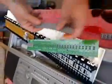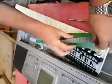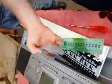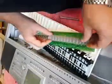Then you can take these circuit boards and wipe them with a cloth, making sure that the circuit boards are all nice and clean. Then the key contact rubbers go back, and you just reverse the whole process and screw the whole lot together and you're good to go. Don't use any kind of spray contact cleaner because the little carbon pads and carbon contacts will be damaged by the spray and then the keyboard will never work again. So: soap and warm water.